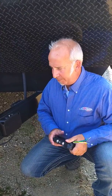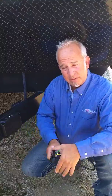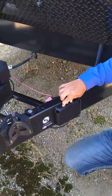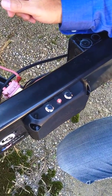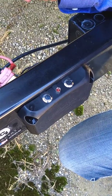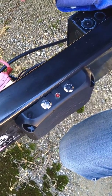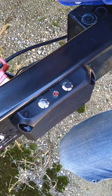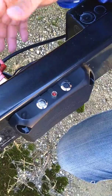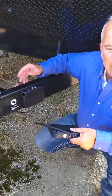So how do you calibrate? Have this wired in. Plug your tow vehicle and your trailer together. Have someone hold the brake pedal down. You're going to hold these two buttons down for just a few seconds, then let go, and it's going to calibrate. You'll see the light indicate that it's doing so. Once the light stops flashing, it's done. Calibration lets Auto Brake know what its new home is — am I upside down? Am I sideways? Where am I?